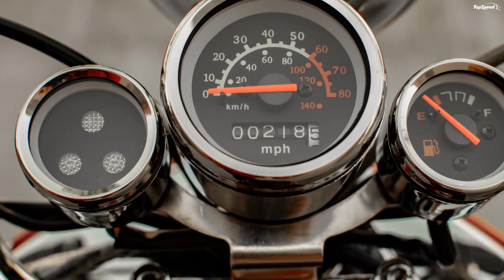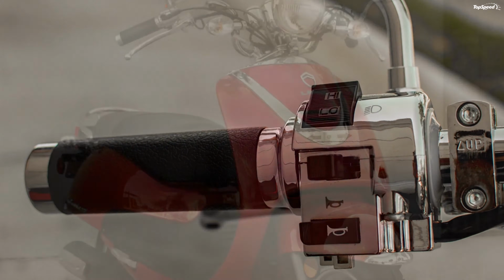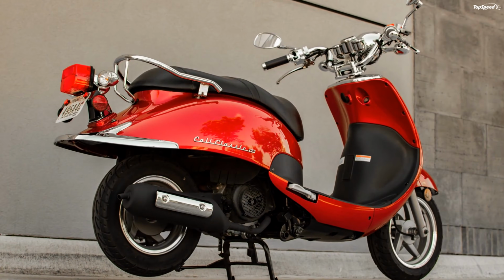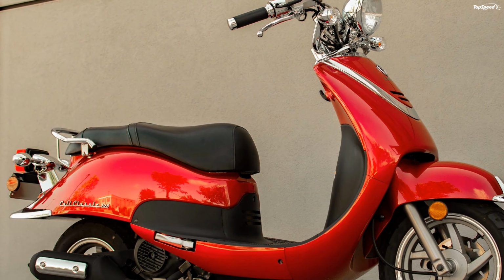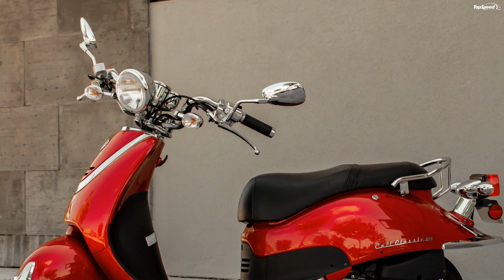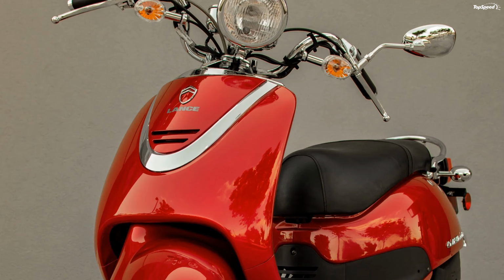Lance Cali Classic chassis. Brakes and the combined braking system put the 200i head and shoulders above its smaller siblings. A tubular steel underframe supports the structure sans help from the body panels, as you would have with a monocoque design. Not only is this an effective building method, but it also makes bodywork more easily accomplished if you bang one up a little bit.